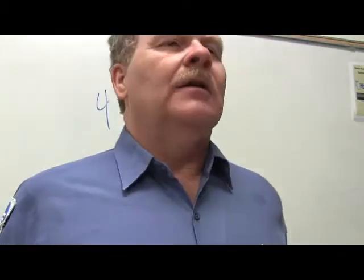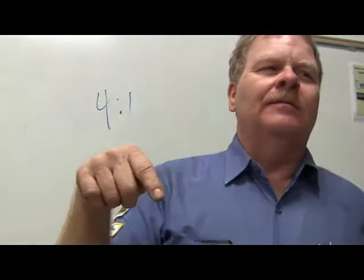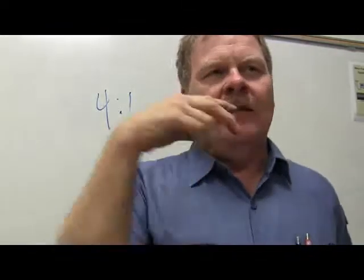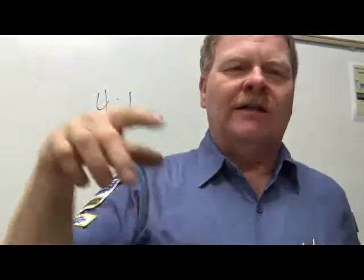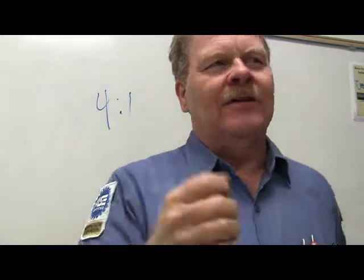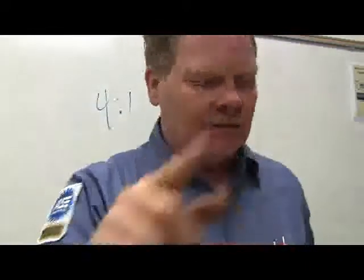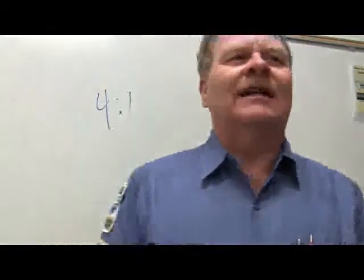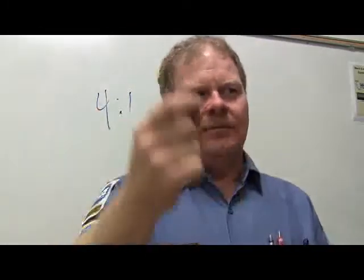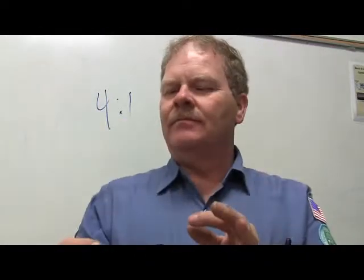How does that work? You got that shift rail, which is them little metal rods, and then you got forks, and those forks actually go around those little sleeves. And it's not a direct connection. It's got several things in between. I'll tell you something else that'll happen there. That little fork is aluminum, and it's got some little inserts on it that are plastic.